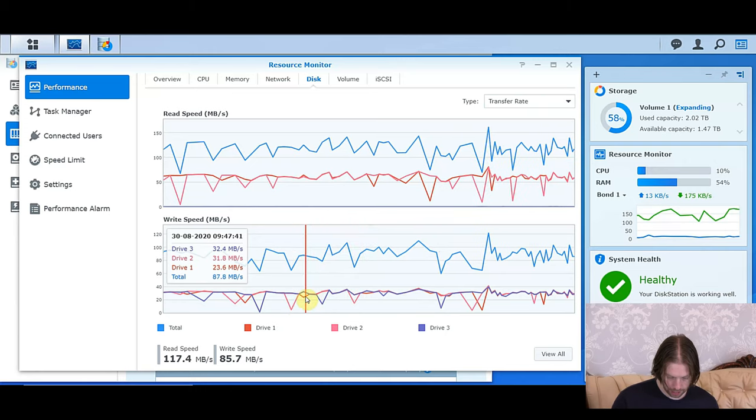Comparing this to the QNAP system, it works so, so much better. When I was doing it for myself on the QNAP, you lost all forms of data analytics — all your drive percentage, all your drive speeds, all your upload and download speeds just disappeared whilst it was doing that. It couldn't handle that amount of data. And then when it did complete on the QNAP, you had to do a reboot to get all the information to start showing again. So the Synology definitely seems to handle this a lot better.